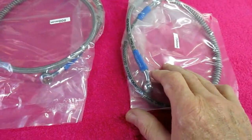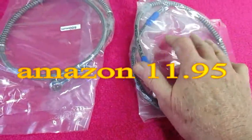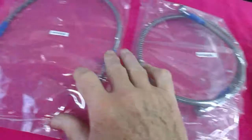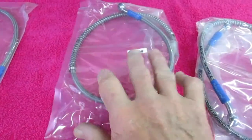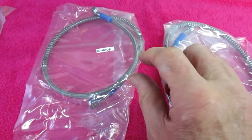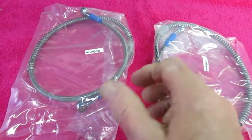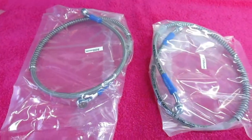I ordered two from Amazon — one a little bit longer, one a little bit shorter — hoping to put whichever one gives me the right clearance. One is 800mm, one is 750mm. I want to have a little bit more clearance around where the brake line winds its way around the speedometer. I don't want it flapping out in the breeze and I don't want it under tension. When the forks are fully extended, I don't want it to be like a violin string.